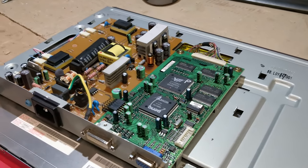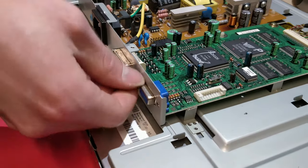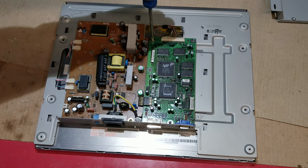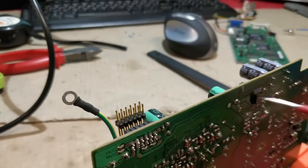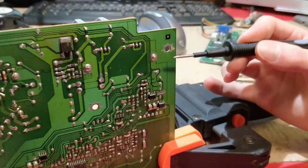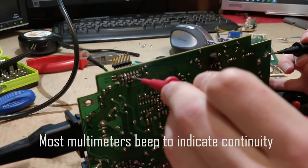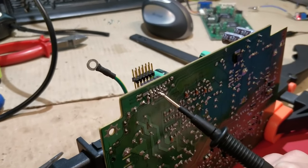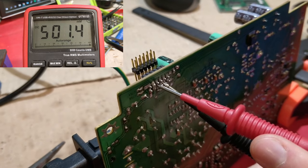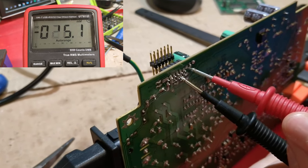We'll power it straight from the PC's power supply, but for this to work we'll need to see what kind of voltage the original power board outputs. This connector will be different for each monitor, but generally it's easy to check which pins are the ground pins by putting your multimeter in continuity mode, putting one probe to a screw hole and then checking which of these pins are shorted to ground. Next we'll check the other pins' voltages against the ground pins. In this case we have 3.3 volts on two pins and 5 volts on two other pins, and the remaining pins seem to have nothing on them, so I'll ignore them.